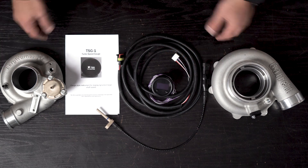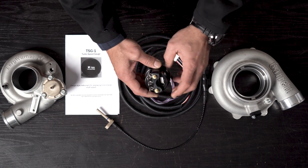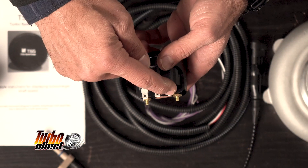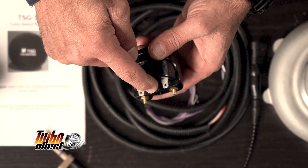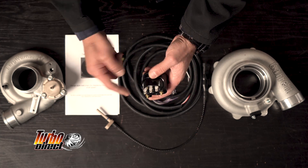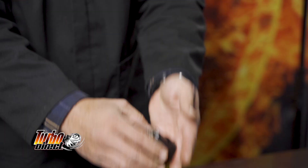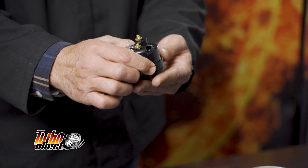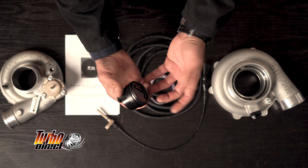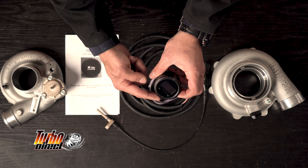So this is the TSG-1 — it's a digital gauge with a little plug at the back. You've got three lugs: one is for 12 volts, the middle one is your analog output which you'll use as your signal for data logging with an external ECU or data logger, and this one is ground. You've got a little cover on the back for installation into either a pod or the dashboard, wherever you choose. There's a mode button on the left-hand side and a select button on the right-hand side.